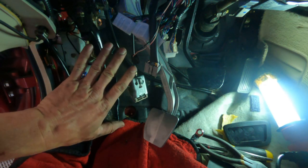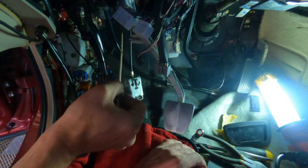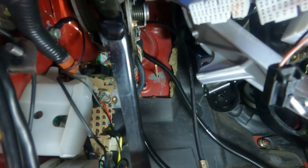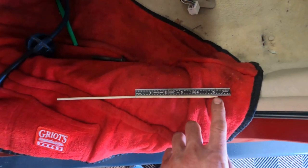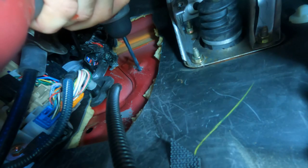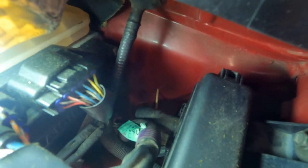There's going to be two layers — an interior layer of the firewall and an exterior layer, so a double wall. Once you get through, I suggest trying to push something through that won't damage any wiring to see where you are. There's the skewer going in through the firewall — it came out in the fender well right there. Once you add a mark on your skewer showing how long it is, you can measure it and go to the store to pick up a bolt long enough to fit that position. Do the same for the other positions so you can go to the store just one time.